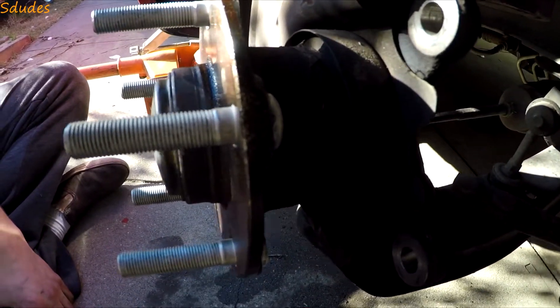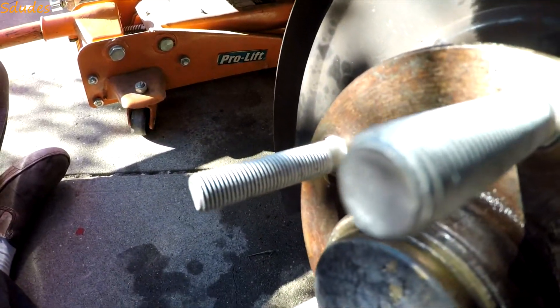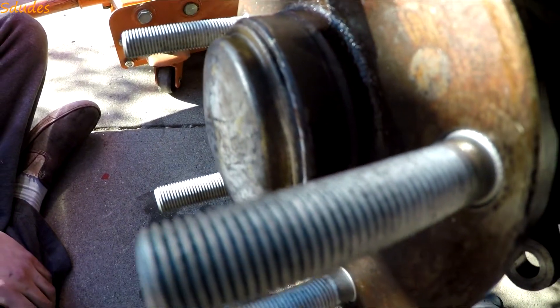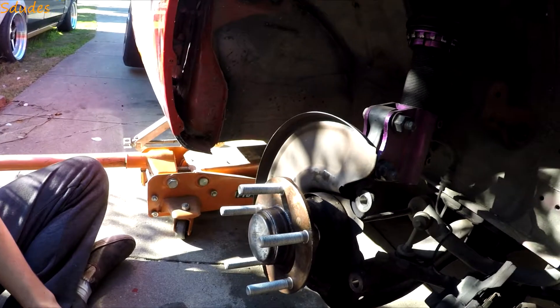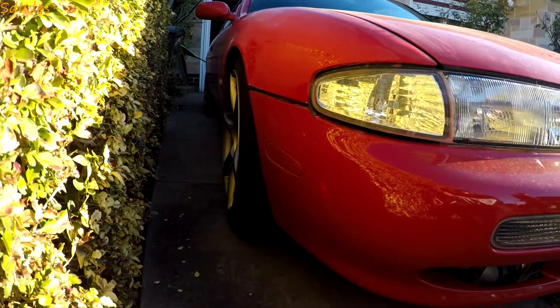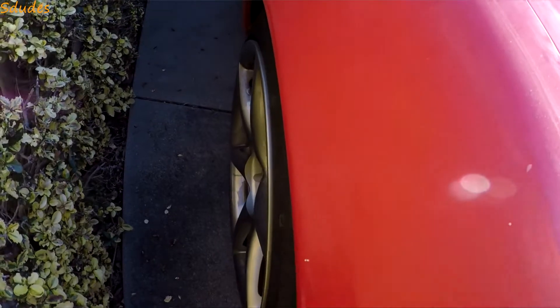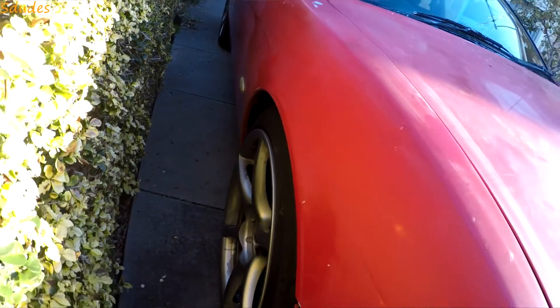As you can see, we've now got all the wheel studs in. They all look nice and are sitting flush — safe, no unnecessary stress put on them. They should last a long, long time. We've also adjusted the ride height, and I think we've got it right sitting at about 60mm from the base of the coilover. Thanks for checking us out — we'll see you next time.